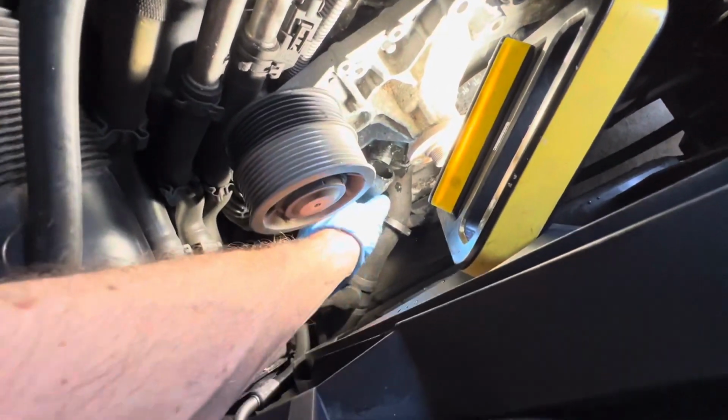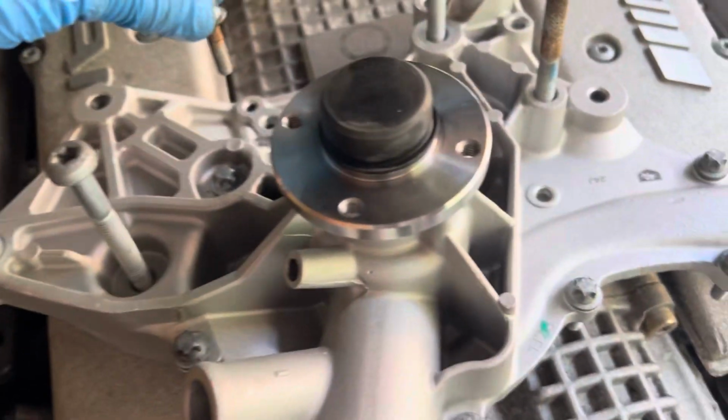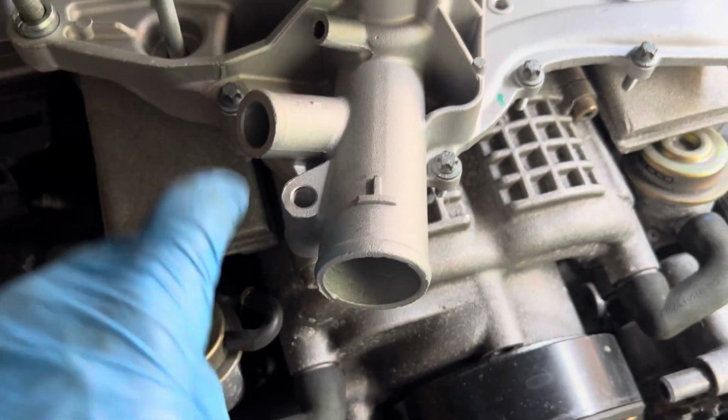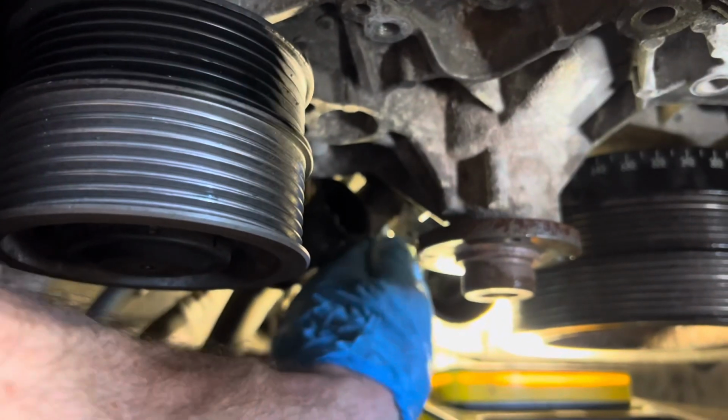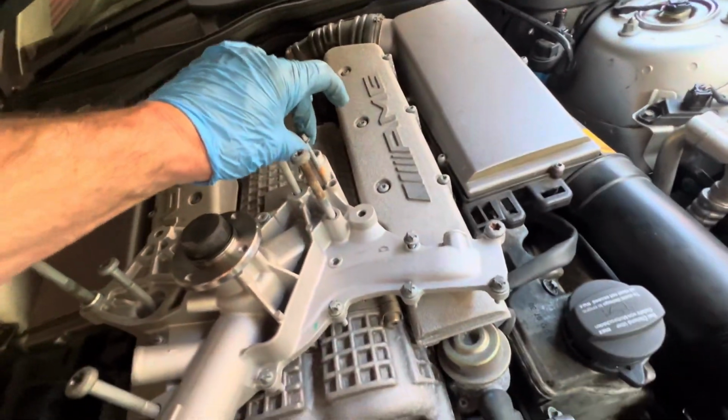There's still going to be some coolant in there, which is going to leak out, unfortunately. That bolt there goes there. I think we've just got one more on this side to get out, and that pump should come off. That goes in there. The advantage of putting the bolts in the holes is I can see exactly where I've missed one. I can see that I've missed one of these Torx bolts just down there by the pipe. These bolts are in so loosely. That goes just through there. I can see I've missed one more bolt here as well, and that goes in that hole there. This is a longer bolt, goes in there.